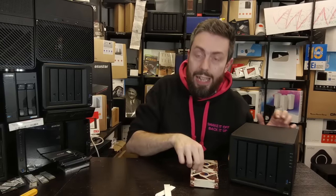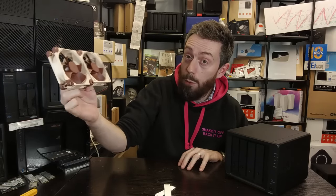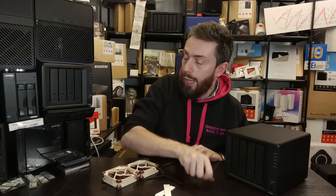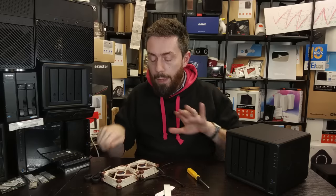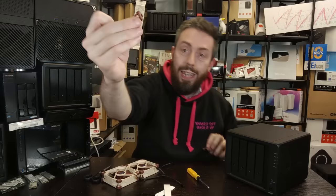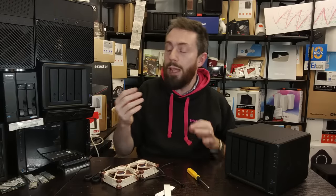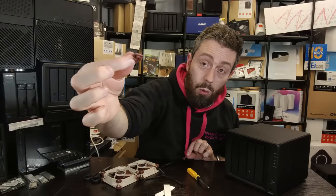In order to go ahead with these modifications you're going to need fans — either one or two depending on the Synology NAS you choose; most two-bay models from Synology have only one fan. Next you're going to need a screwdriver and a set of scissors. Most Noctua fans also arrive with rubber edges on every single fan, and depending on the Synology NAS you use, fitting these fans can be a bit of a tight fit — you may need to remove some of those corners.